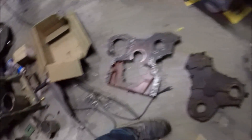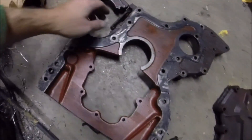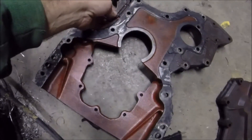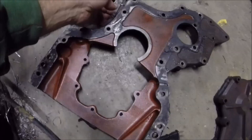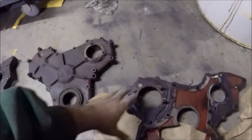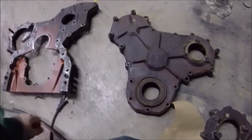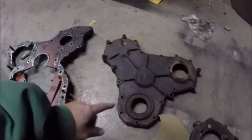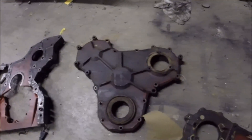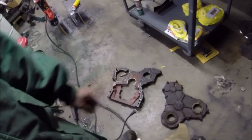Now let's take a look at the work we've got to do. This timing cover here had a bit of an accident — the engine had a catastrophic failure and knocked the pump offside and broke this timing cover. So the customer has a new cover here, which has the wrong bolt pattern and too small a hole in it. So I've got to open that up, drill it out, put the right bolt pattern in it to match. And there are actually two timing covers — I almost overlooked the second one that was underneath.